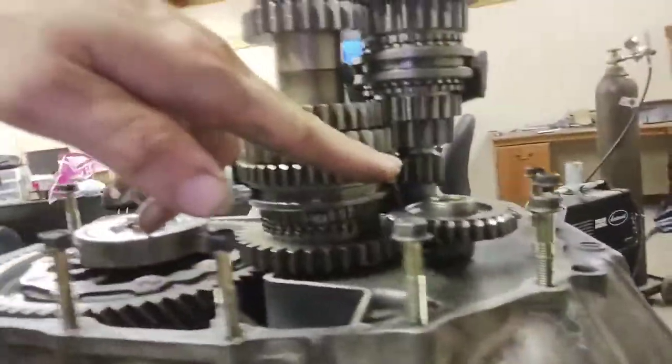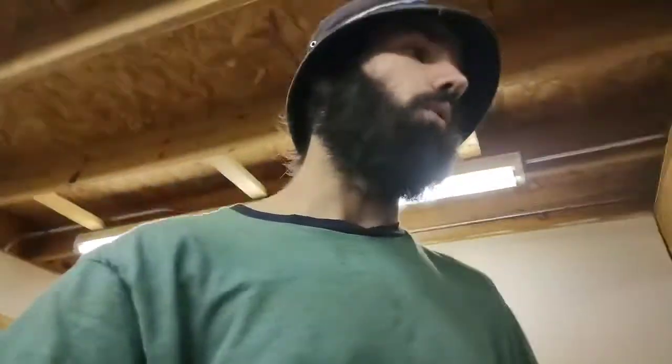That spacing down at the bottom really does play a big part in this whole transmission. One is a thrust washer and one is the shim. So the top one is the alignment shim. The bottom one, which is concaved, they say acts as like, it keeps pressure, it keeps load on the shaft. Don't ask me how, I'm not a transmission expert, but that's its job. So they have to be there, and without that, it doesn't want to do what it's supposed to do.